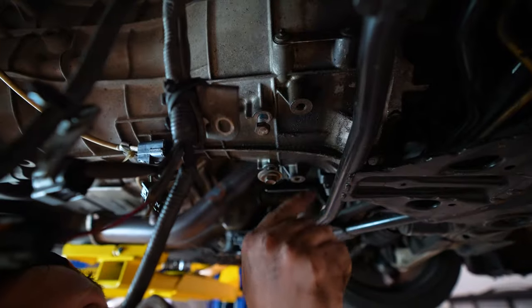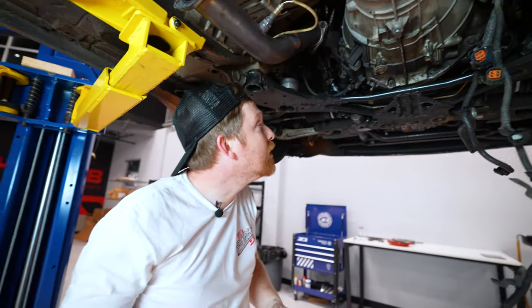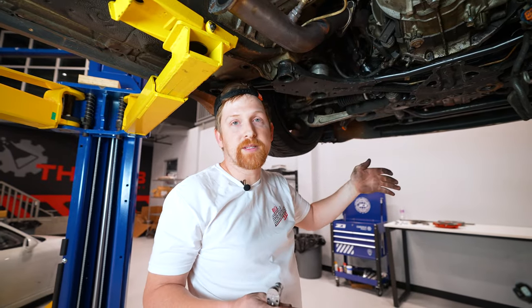Those are metal shavings. Front row. Looks like somebody started. That's not a Nissan bolt. That's why. Let's do the slave cylinder. If you're not replacing your slave cylinder, if it's not leaking or showing any signs, just unbolt it from the side of the transmission and just kind of tuck it out of the way. That way you don't have to open up the system.